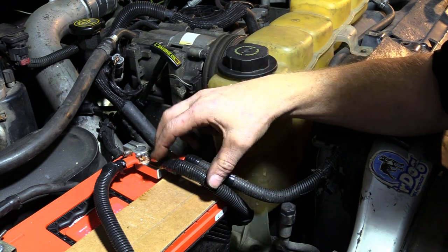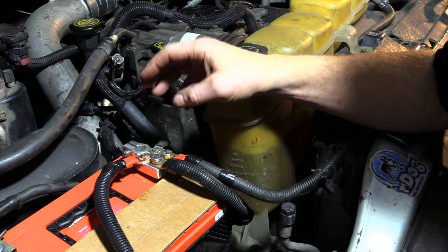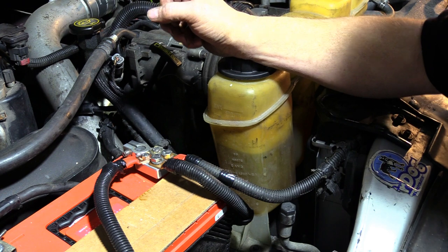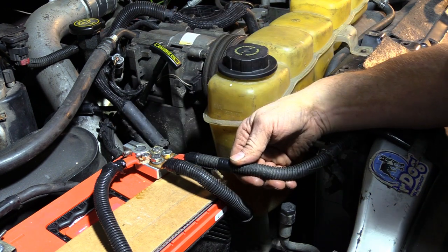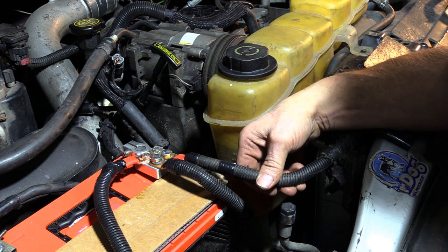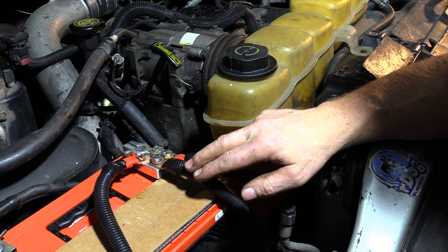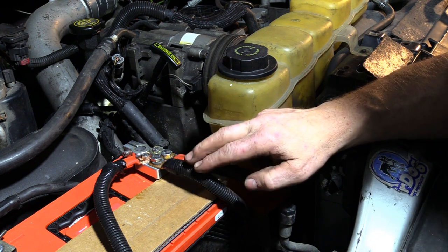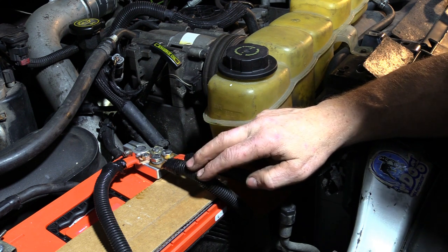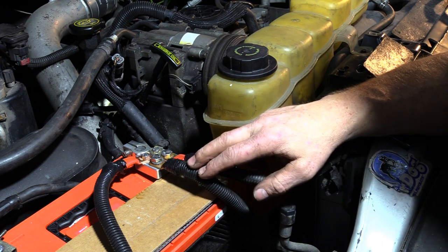These are for the alternator and for the extra battery and for the starter. Notice how it's nice, neat, clean, all nicely lugged, heavy duty lugs. We have heavy duty wiring. We've pulled out the factory wiring and we've put in, from the battery to the battery here, a 2-gauge. We have a 1-aught for the starter, and that right there is actual welding wire. The welding wire has more strands in it, allows more voltage to pass with the least amount of resistance.